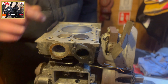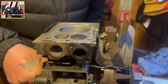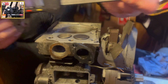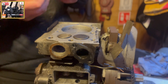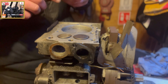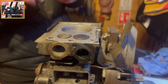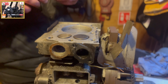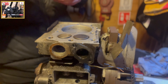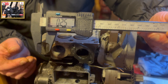The piston is now at top dead center on the compression stroke. Now what we want to do is back that off. Get the old calipers out - we want to be a quarter of an inch off top dead center. Set the calipers up - turn them on. We want to be a quarter of an inch.